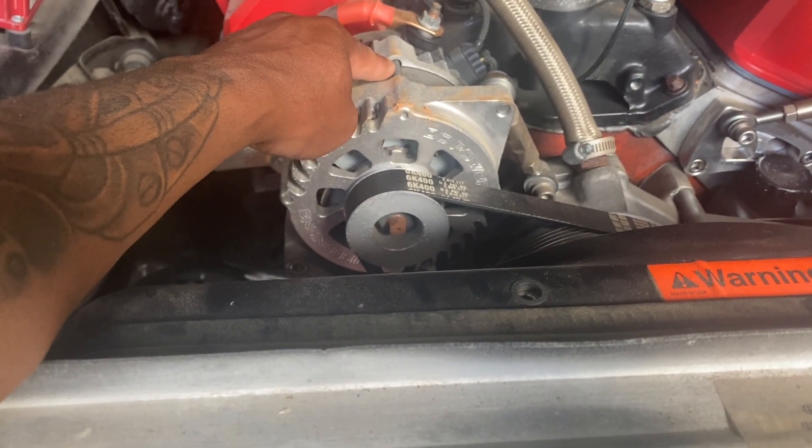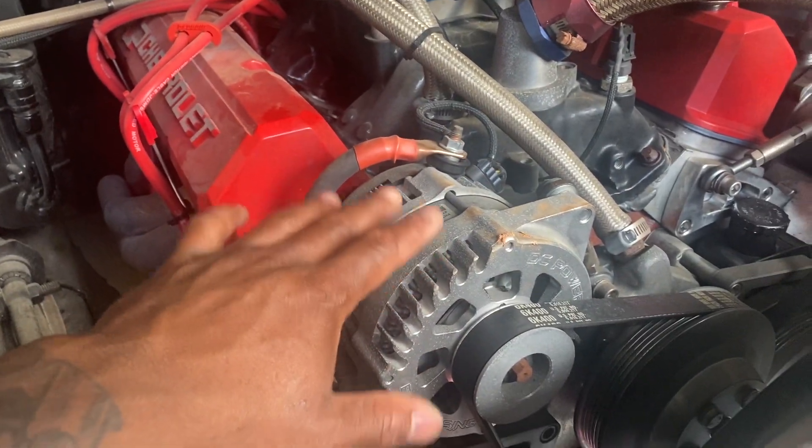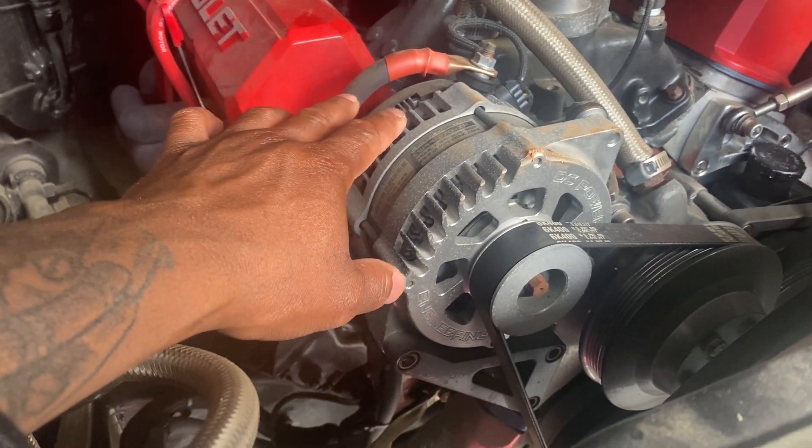The reason why is because I think this thing might be set at like 14.0 volts or something, and it ain't enough. When I crank it up I want to put it at like 15, but I gotta do some research. If I can go to like 16 I'll be good, because when it dropped, the high-amp equipment cut out. I want to keep it at a minimum of 13.5 and I don't really want my lights going crazy, so it's just cheaper to get this one fixed than to buy another one.